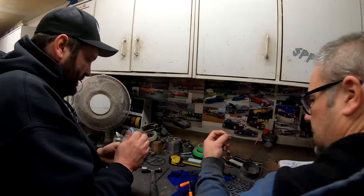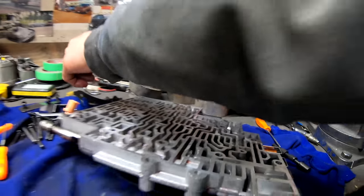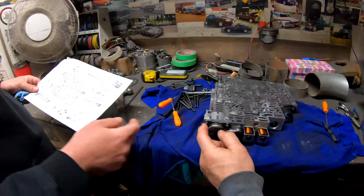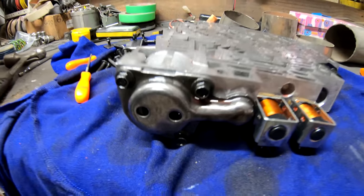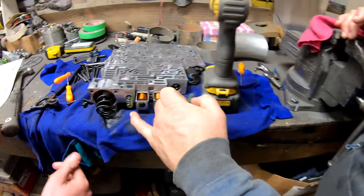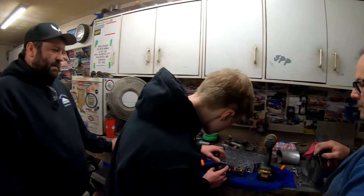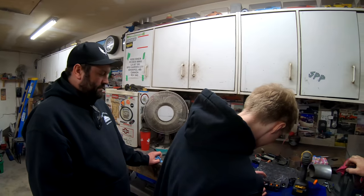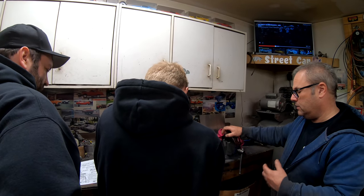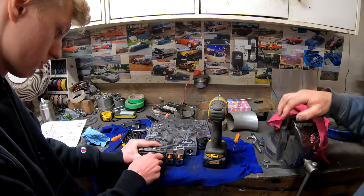I ended up using a drill bit that came with the kit, put it in there and used it as a little easy-out to pull it out. Now we take this 1-2 shift valve off and change out a spring. Step six: take this green spring and replace it with the yellow spring from the kit, then put this little cover back on — that's all you change in there. Basically like a game of mousetrap — all the springs, changing the way the oil flows through things and how much pressure it needs to shift and change gears.